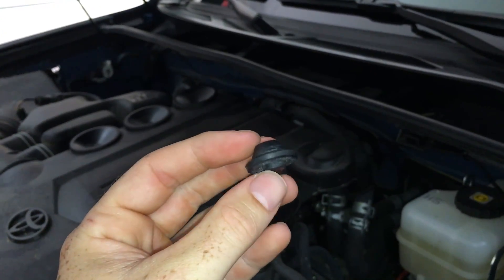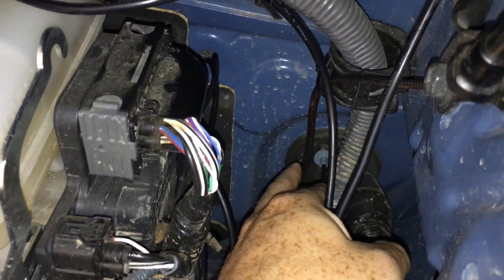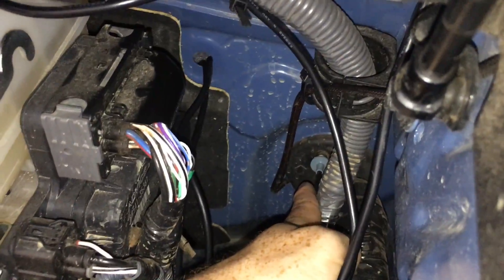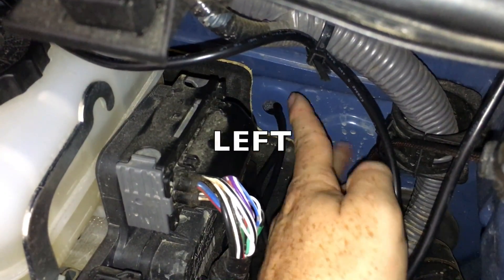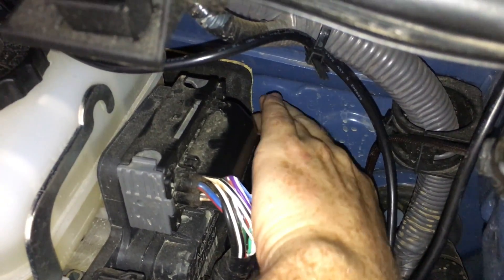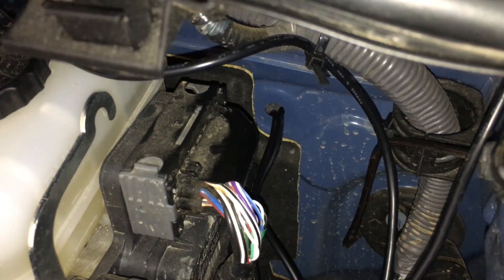The first thing you've got to do is take this little grommet off. This grommet used to go right there — this is like your factory harness. I have the amber lights wire going through that because I didn't want to take up space over here. If you see your factory harness down here from the firewall and up towards the right, you'll see this little grommet. Pop that grommet out and basically just send your wires down as far as you can. Just keep sending them down and they're going to be inside your cab.